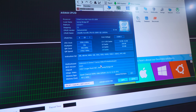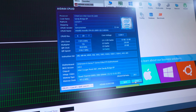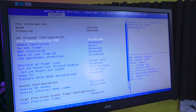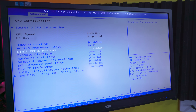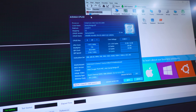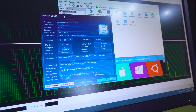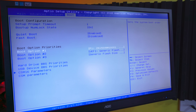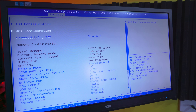Going into CPU-ID and AIDA64, it was interesting — it showed an H67 chipset rather than X79, but it was still showing quad-channel memory. So the memory is running in quad-channel via some kind of weird hack. It is working, and quad-channel memory delivers much more memory bandwidth over dual-channel DDR3. The board also supports registered DDR3 memory, so you can save money going with registered RAM which generally costs less than unbuffered at current market prices.